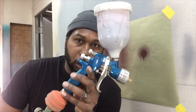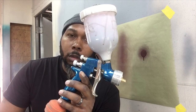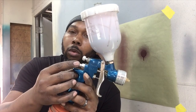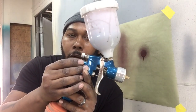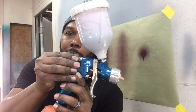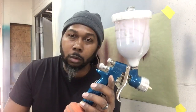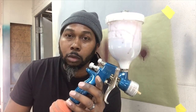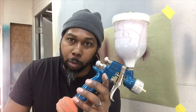In this video I'm showing you how to set up your gun at home. Once you've got your spray pattern and your fluid set to two to three turns with the fan open, if it's looking a little funny, close your fan just a quarter turn and you should be good. But you've got to play with it and adjust it — I don't know what type of gun you might be using, expensive or cheap, so you've got to find that sweet spot.